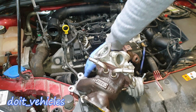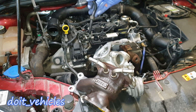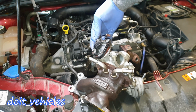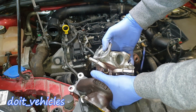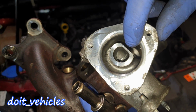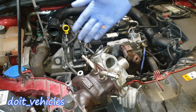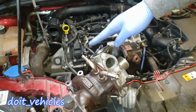So here comes the valve, which is vacuum actuated. And by the way, when you decelerate, you have the maximum vacuum in the intake manifold. Therefore you have enough power to activate this valve. So when it is connected here, it will open up like that, it will be pushed like that, and the air will be able to travel basically from this side through that channel down there. It will come and travel back through the intake pipe where the mass airflow sensor is. Since over time, if you expose these intake pipes to too much pressure, then you'll find leaks very often, and that's why you've got this blow-off valve.